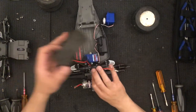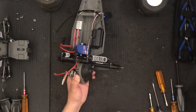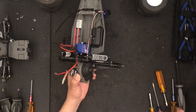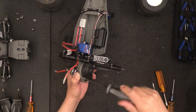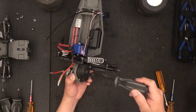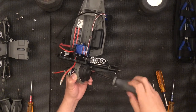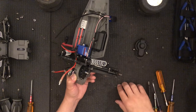It's just a 7 millimeter driver for this. Go ahead and remove this little cover. One thing I recommend is if you do not have this little rubber bit, replace it with one of these because you can simply remove that little rubber piece and have access to the slipper and make adjustments to the slipper clutch. A friend and I were racing not too long ago in a spec slash and his slipper was too loose and came loose — sometimes they loosen, that's something you have to check. But you have to remove the wheel and then remove this to access it.